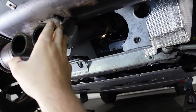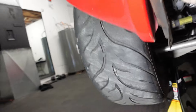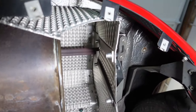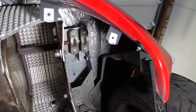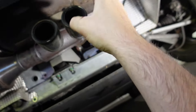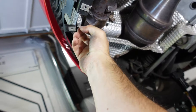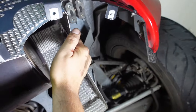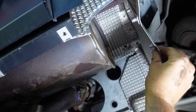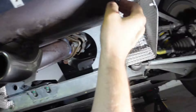What we're going to do is come over here — there are two hangers on this side, eight millimeters, holding up the exhaust canister. It's going to weigh a lot less. We're actually going to weigh it in this video. There's a clamp right here that's actually welded onto the exhaust, so it'll probably come out with it. These are eight millimeters up here. There is a cool little heat shield gap so that the exhaust can come out — smart design, good job Lotus.